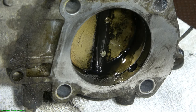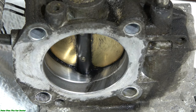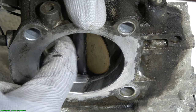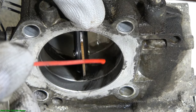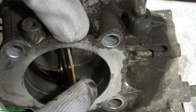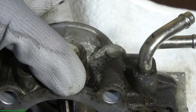Now I need to take all of the dirt away, and soon we can see how clean this is when I use the cotton cloth. When cleaning the throttle body valve, I can press this side and open it totally, then clean this area, this side, the border, and the central part. With my fingers positioned here, I can also clean the middle areas better.